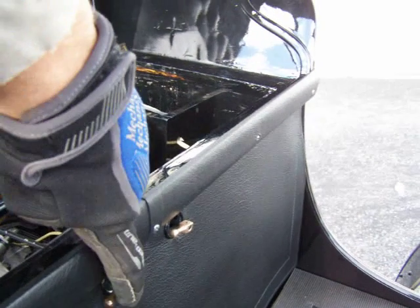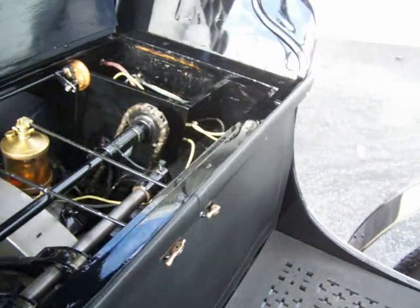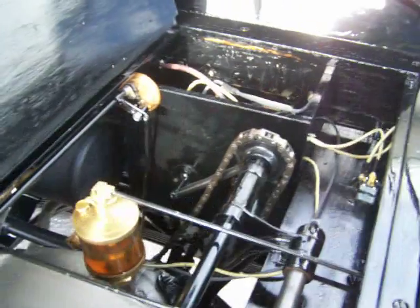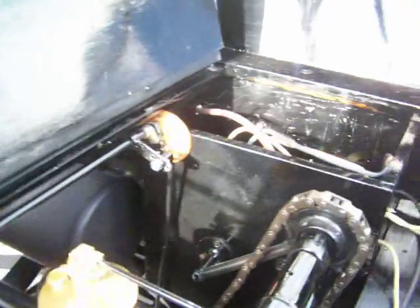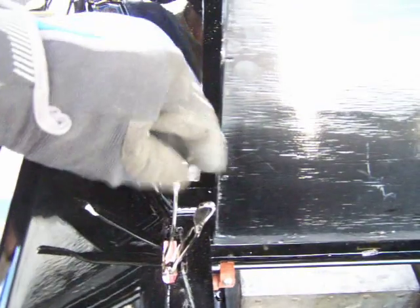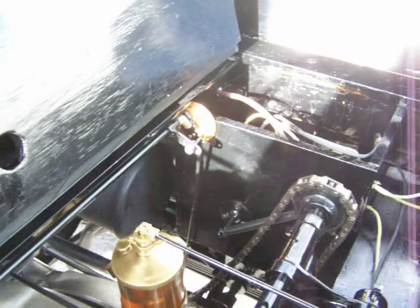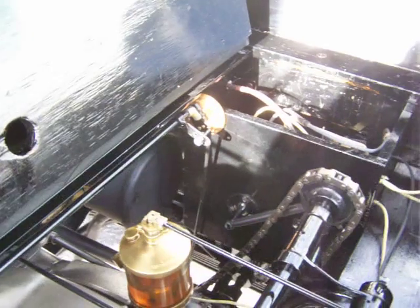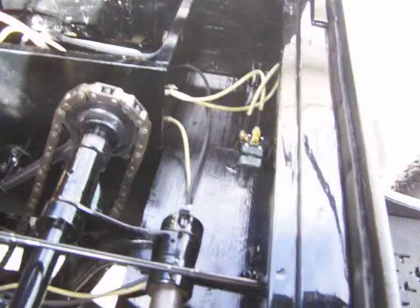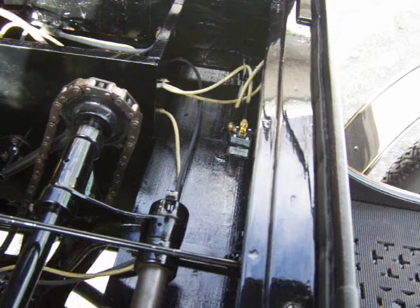This is your carburetor adjustment, but since we don't have the original, we just have it there as a dummy — we don't have the original carburetor. That's your ignition and spark advance and retard, with levers over here for both of those. We were having problems — the engine vibrates so badly it was giving an inconsistent ignition, bouncing around so much. So we bypassed that to a regular switch down under here in this box. It's hidden away but still easy to get to.